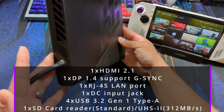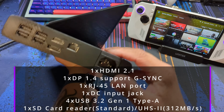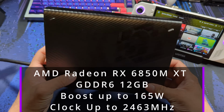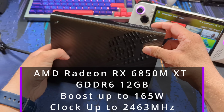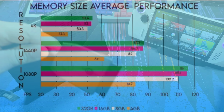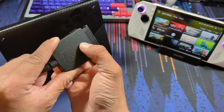The other downside to this, obviously, is only having 16 gigabytes of memory. When using the XG Mobile, you must set it to auto to be able to access all 16 gigabytes as system memory. However, in 4K gaming, if you own the 4090 or honestly even the 3080, system memory is becoming just as important, and the 16GB will eventually bottleneck you in these situations. We've already seen this in games like Diablo and Forza, where they have the warnings. Diablo will even lock you out of using higher textures at certain resolutions. So 16GB at 4K is paltry.